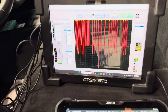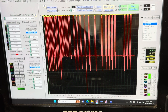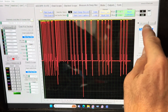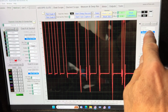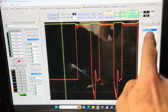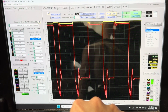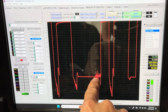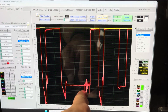So you get this vehicle that comes in — they say it's an intermittent problem at the latch, won't open. You sit there and open the latch, it's working fine. You do the wiring diagram, get to the relay. This is not malfunctioning right now — it will open every time — but I can tell you the relay is no good. Right here, if we blow all this up, you're looking for something bad. This is the relay on, off, on, off. Right there is a mess up — it turned on but had a voltage drop and didn't actually close. That's a problem. Here's another issue — you can clearly see it tried to come on, didn't make contact, and then it did make contact.